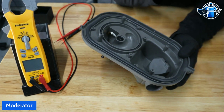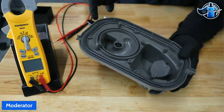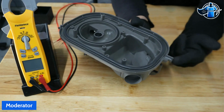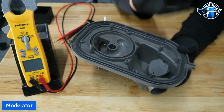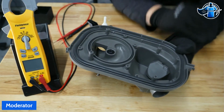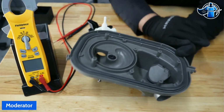Those pinholes, and what's crazy is, like I said, Scott in Mobile had the same issue. Little small pinholes that we're finding developing on the tub are going to catch right here on the sump and redirect it towards the front into the tray. So if you see water coming out of right here, it's most likely not going to be this seal. Of course, you want to pull it off and inspect it, but it's most likely going to be some type of really small pinhole. The only way I was able to find it is to use a flashlight on the back side, let it shine through so you can see any potential pinholes, because they're going to be so small. If you're not really paying attention, you're going to miss it.